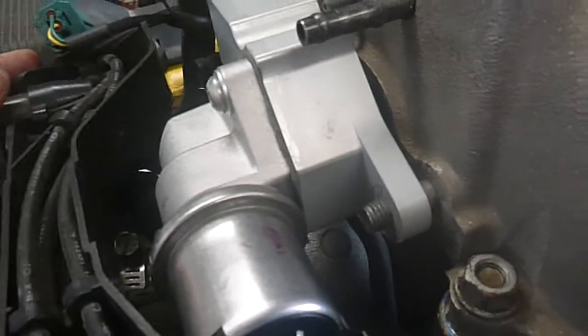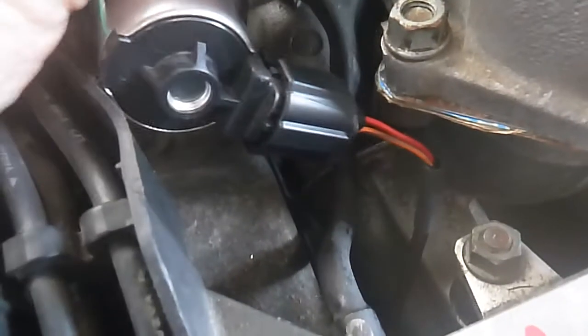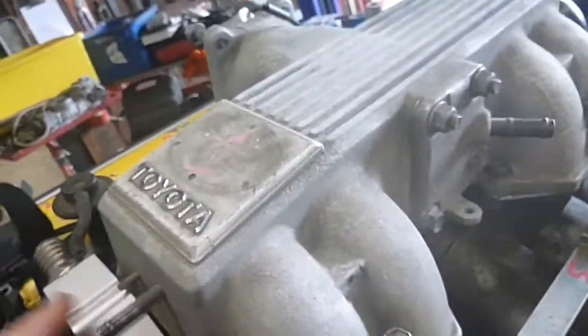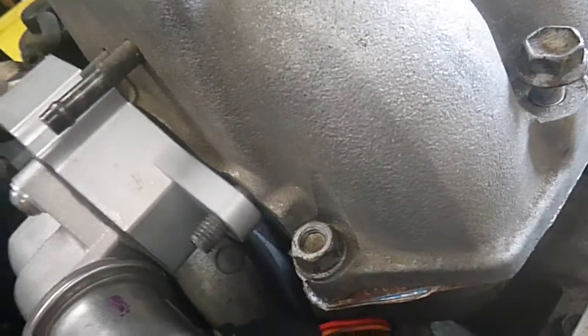Fitting the stepper — you've got a new stepper set up. Take the original motor off. I've got a new gasket for you, I have one left in stock. Slide it on. I put the wiring underneath the rail — don't go over the top, it'll look ugly. And up into there. I've given it some basic numbers in the Link but it will need setting up properly. Okay, hose — factory hose coming in. So that's nice and simple. And you want to plug it in because it's really close to the manifold before you actually do it up. So put the loom on, sit it in place.